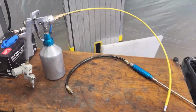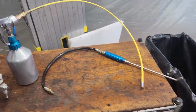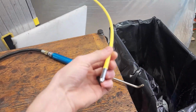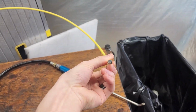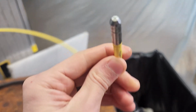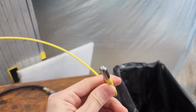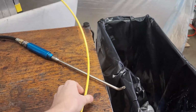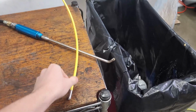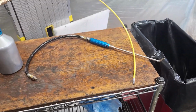And I meant to show you, as I just mentioned, this is the special air applicator for the Fluid Film that we use. Right now, there's our snake attachment on it. Very long, flexible rubber hose with a little metal tip. And what's cool about this metal tip, we can see there's not just one hole in it. It has a special spray pattern where it sprays 360 degrees around. So this isn't just spraying in a straight line, it's spraying all around, fogging the area. So when we get this in the enclosed areas, we know it's a complete coverage.